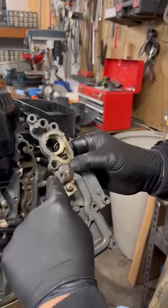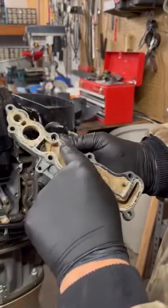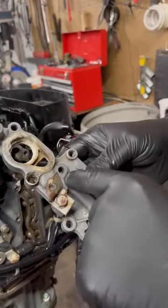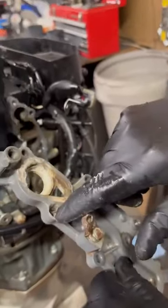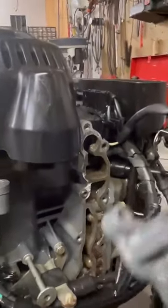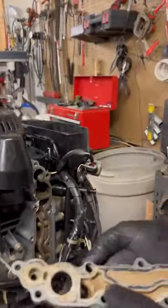They had broken a bolt off — heat and patience to take those out. They broke a bolt and went to drill it out, but when they drilled it out they made it too big and cut into the gasket. The motor had overheated at one point and this cover was cracked anyway — there's a fine crack in it right there. They had helicoiled through here, which is a good technique, but they helicoiled through here and into here, causing it to be one piece, so you couldn't replace this without pulling the helicoil and destroying it. They had way too big of a bolt in there, so it had cut into the gasket itself.